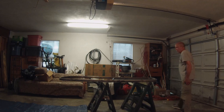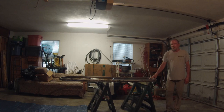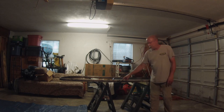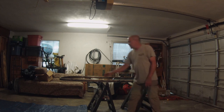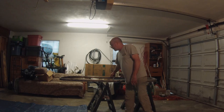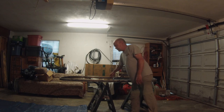Okay, so today we're going to talk a little bit about these windows. This is a PD4104 window. It is not out of my particular bus, but it came out of one of the buses that is similar to it, another PD4104. These windows consist of an extruded aluminum rail frame that's obviously extruded and then at some point bent around in a jig, probably in manufacturing, and then brought together on the ends. And then there's a little plate that joins it with screws in it.